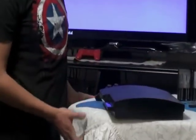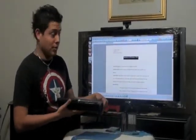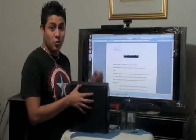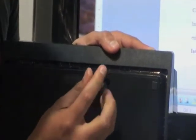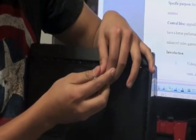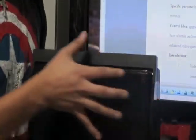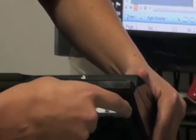Place your PlayStation 3 on a flat surface, then we're going to take out the internal hard drive, which is located in the front part of the PlayStation. For this, we're going to use a flat-head screwdriver. We'll see a little cover under your PlayStation 3 — pop it up, grab your cross screwdriver, unscrew it, slide the cover to the left and take it off, then carefully slide the hard drive out of the PlayStation 3.